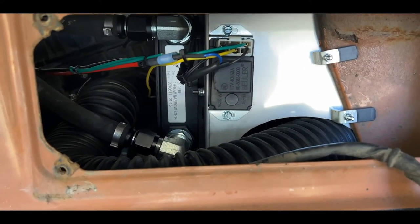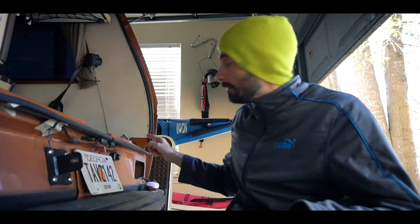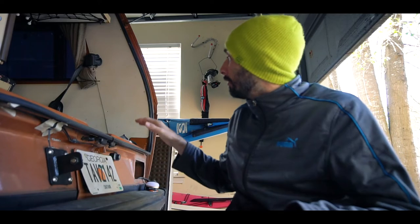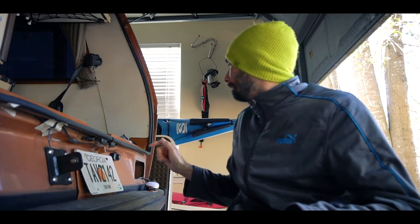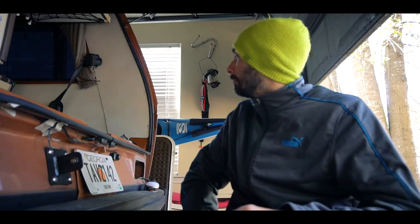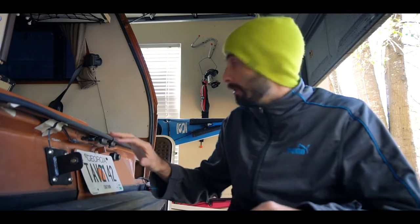Control module is now all hooked up and wired up. It's a new day — the oil cooler is installed, the hoses have been run through, I have zip tied them down for now, everything's been tightened down, the air intake hose has been routed through, and I did the wiring last night. So pretty much everything on the oil cooler is now on.